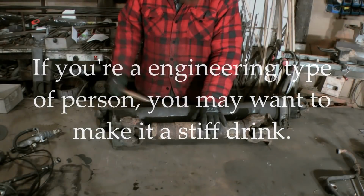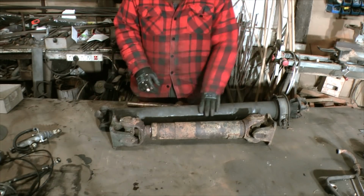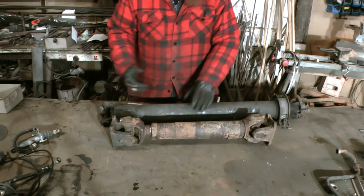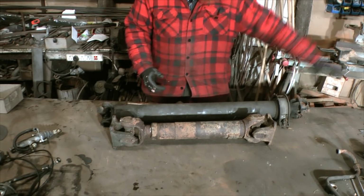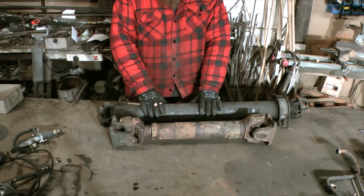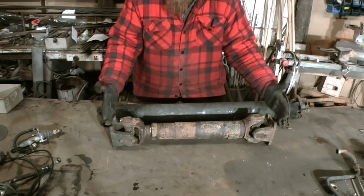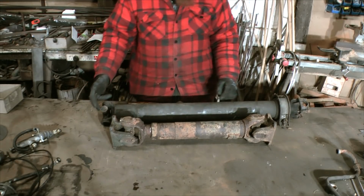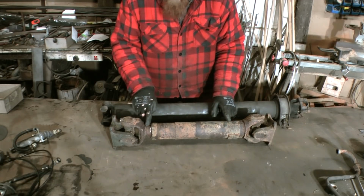This is the prop shaft from the Zil. It went from the engine to the transfer box. This is the first part of the prop shaft from the DAF that went from the gearbox to the, well, on its way to the rear axle through another joint. And I have to mash the two together somehow. And they want to end up as an overall measurement of 600 from one face to the other face. Well, from one face to where this bit goes there. Roughly 600, because there is going to be a bit of give in it because we have a slip joint here, so that's good.